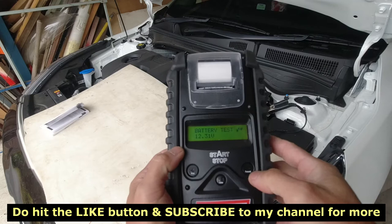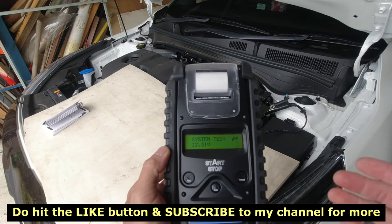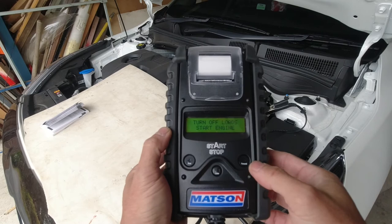Now instead of doing a standard battery test, I'll press forward and select to do a system test. This is where it incorporates the test of the alternator, whether the battery is receiving a charge. Press enter and it says turn off loads and start engine. So I'm just going to go to the car and do that.